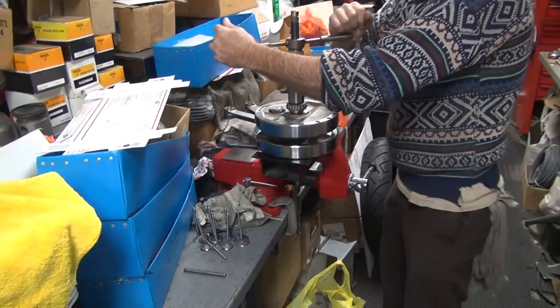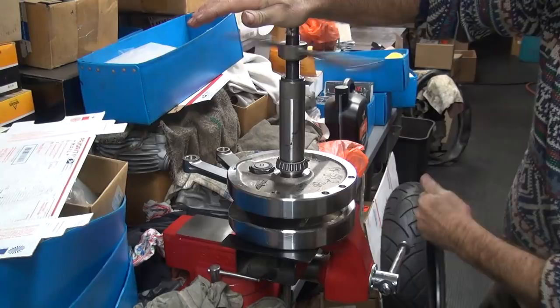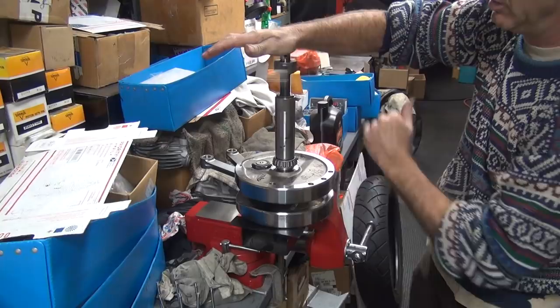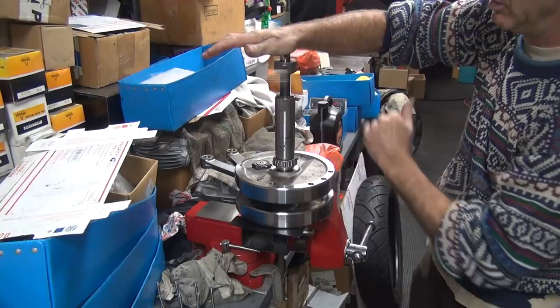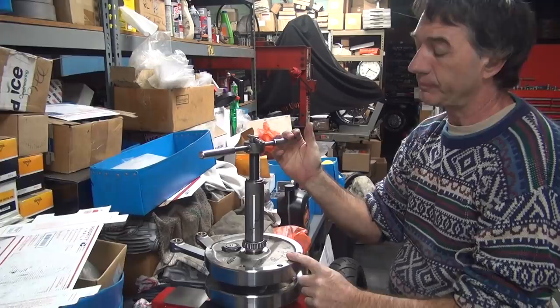We're now bottomed out. Hold that part so it stays on there. We have a roller bearing right here - a thrust bearing to make it easier for me, not necessary to have but it does make it work a lot easier. S&S makes a rack and pinion style tool that I don't like but I have them. The problem with it is it goes real quick down, puts a lot of stress in the wheel because you've got to yank on it with a big breaker bar. The biggest thing is you can't put a steady load on it - you go down and stop, so you can't have a fixed tight load and then check something, which you'll see in a minute.